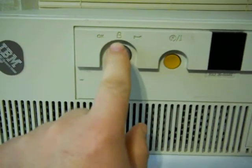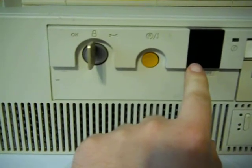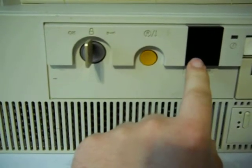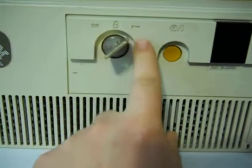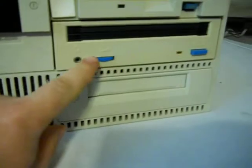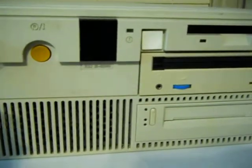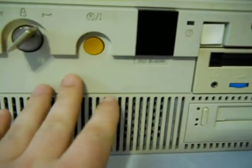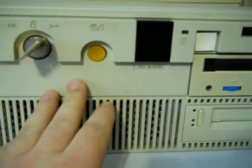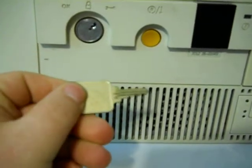The lock position will power on and boot, but it will just display I believe 200 on the LED display. And then maintenance mode triggers it to boot off of CD, tape, or floppy instead of the internal hard drive. And if there is an internal hard drive, it will go into a maintenance boot mode. A special note — it is a Medeco key.